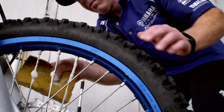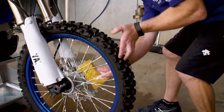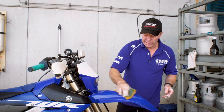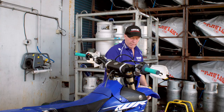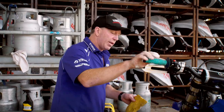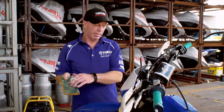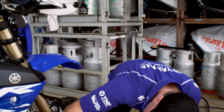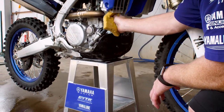Spokes are the same — just spin the wheel. It's always nice to have clean, shiny spokes. Some tracks have a lot of alkaline or acidity in their soil, especially if they've been using bore water to keep the dust down. That generally stains your frame as well if you leave it on too long. So use the scourer side on the front part of the frames and even on the bottom of the radiator tanks. Just a light scour across.